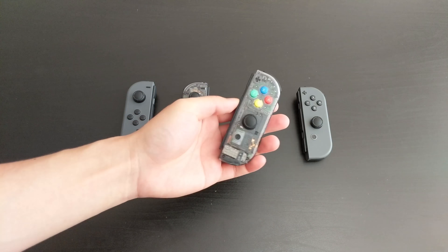Another thing to be prepared for is that the battery is held down by double-sided tape — some components are held down by double-sided tape. The tape and battery were actually stuck to the original case. I found out afterwards that I didn't transfer the double-sided tape, so when I shook it, the battery would slide around and I could hear it clicking. So I took it apart again, removed the tape from the old case, put it on the new one, and stuck down the battery. Just bear that in mind — take the tape with you so that nothing is wobbly or shaking inside afterwards.